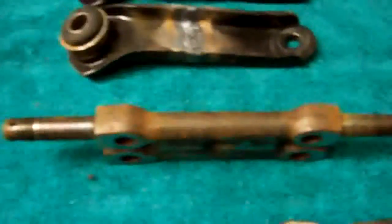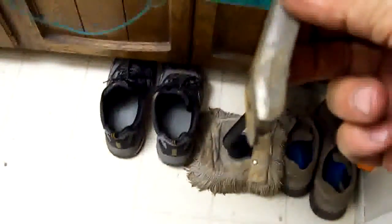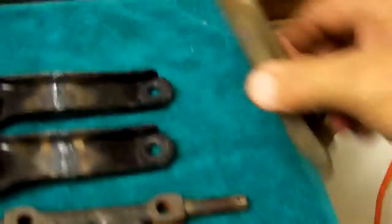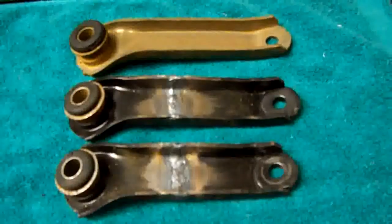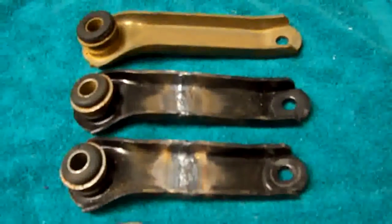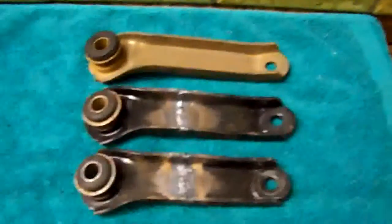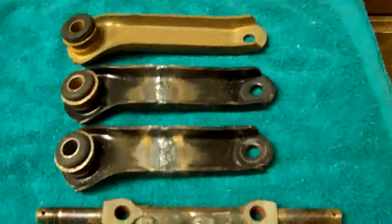And then these are the A-arms that physically go onto it. They sit on like this, one on both sides, and then it's held to the top of the kingpin. Now what I've done, and I'm going to experiment with here pretty quick, I'm looking for a negative camber. In other words, I want the top of the tire on the inside of the wheel well towards the middle of the car, and the bottom of the tire I want sticking out a little bit.